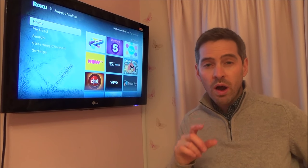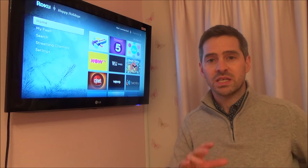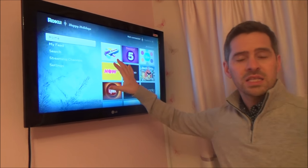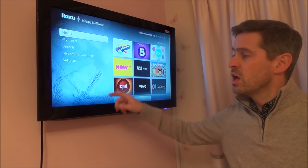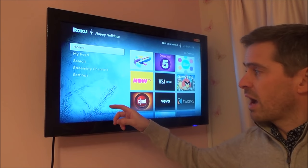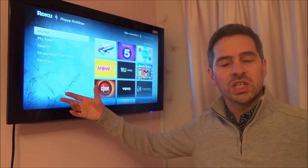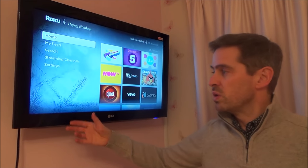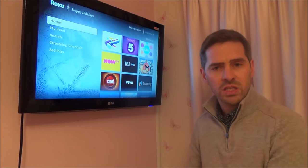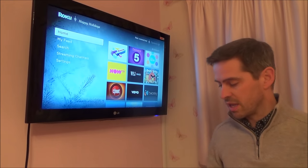The picture may not be quite as good as using an HDMI cable, but most people won't notice. The story with this TV is quite a few years old — it's a 1080p full HD TV, but unfortunately the HDMI ports blew a while ago. I managed to fix it by heating up the HDMI chip and it worked for a few months, but then they blew again. This renders the TV useless if you want to connect up your Xbox, PlayStation 4, or whatever, since you're forced to use an HDMI cable.